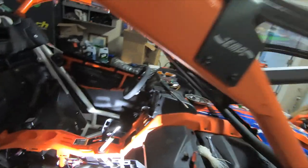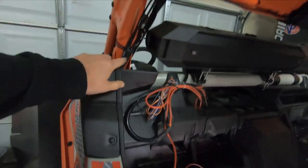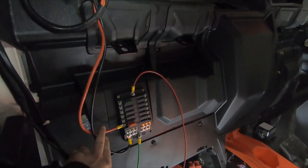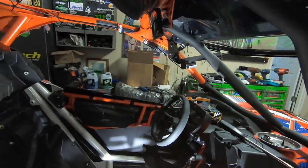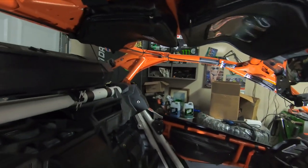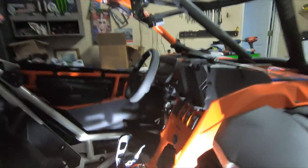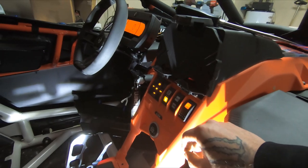Got my wiring and stuff ran. The light in the garage is a little dim and it's cold outside, so bear with me. I got the wiring for the motors for the power flip up and ran. I also started running my harness for the light bar. Got the fuse box and stuff installed where it's going to be, and then the mount for the relay for the light bar. You can see where I ran the wiring harness — I know you're supposed to run it through the cage but I didn't want to. Got my switch working; it's on accessory power so it only comes on while the accessory power of the machine is on.